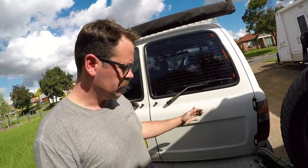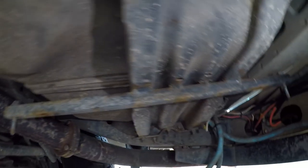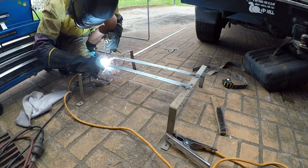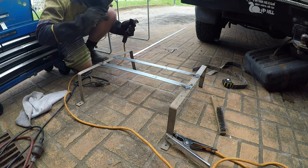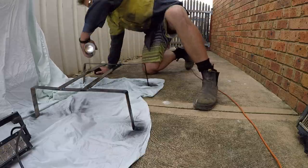Up underneath is just a 60-litre caravan water tank. The idea behind that was it's nice and lightweight — it was a trial. I just welded up the frame to make it fit, and if I liked it, I was going to get a stainless tank built to suit the space under there, maybe a little more low profile. But to be honest, this setup has worked so well. I've had it for five years and all I've had to do is add a new pump because the old one wasn't priming well, and weld on a bit to the straps because when it was full the tank was sagging and the straps were pushing out.